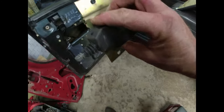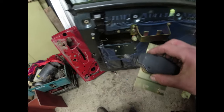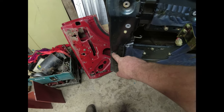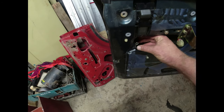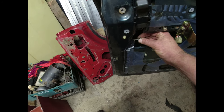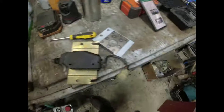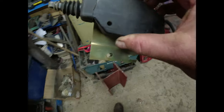There's been some gibbonry going on in here. The problem actually is there's a spring in the lock mechanism on the handle and it isn't doing anything, because there's no solid action or feel to the lock. Because of that, someone's overcompensated by adding a whacking great big spring attached to the underside of the plunger, and massacring the mounting plate for the central locking.